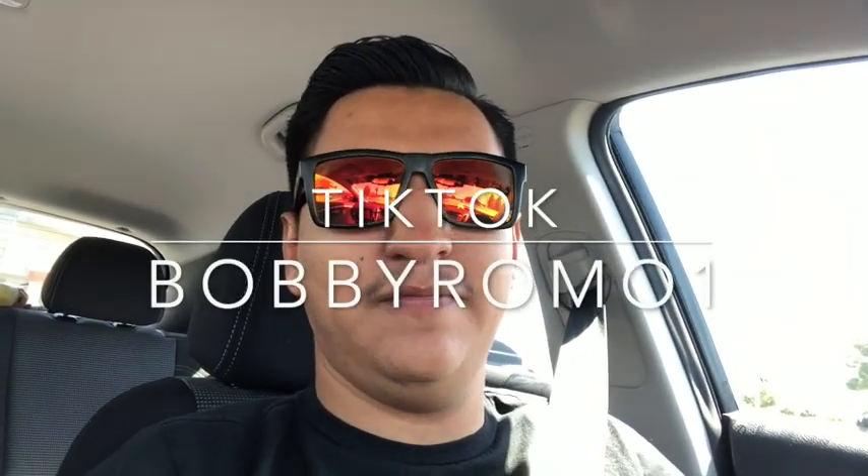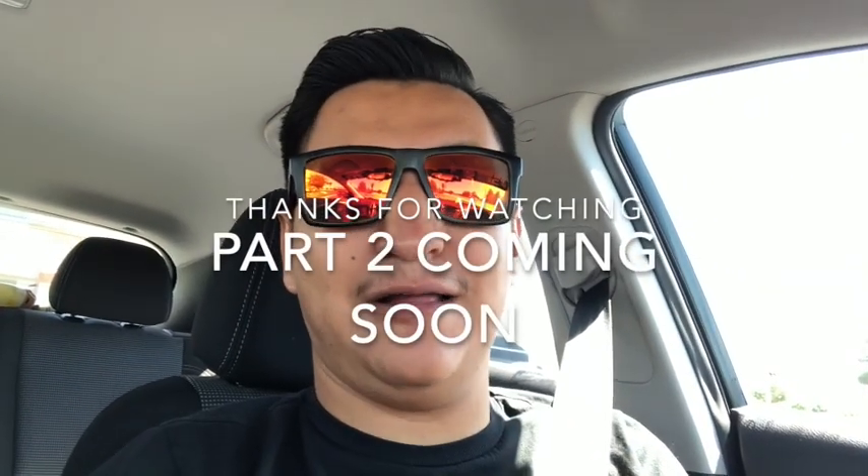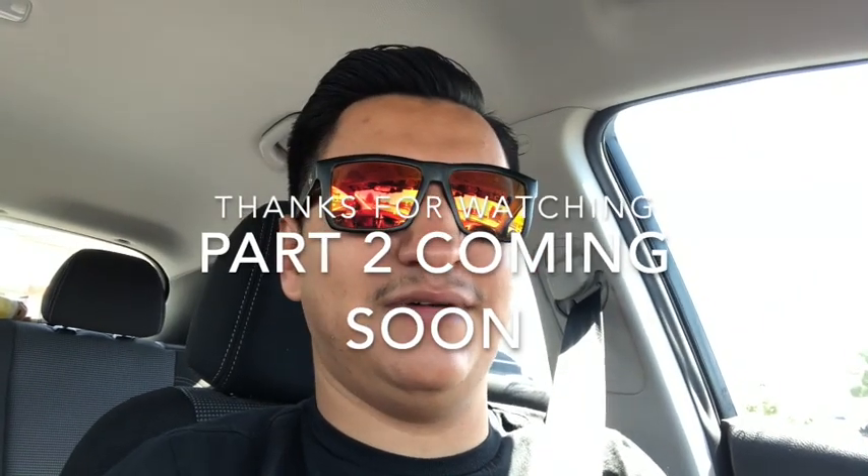They were scrambling around in the back and couldn't find it. It turns out they've only ever had one other set ordered since 2017. So basically, I have a very rare brake pad. Most people just grind down the brake pad they have in stock. Since I have the Street Glide to ride to work, I just ordered the right one. Note this down: if you have a 2006 or 2007 Softail with a 200mm rear tire, you need to buy a specific brake pad just for that, or grind down the standard ones — otherwise it will not clear the caliper.